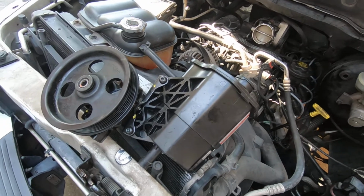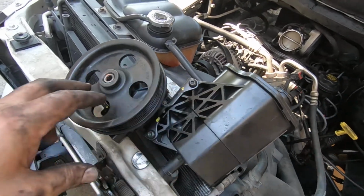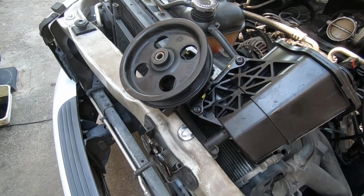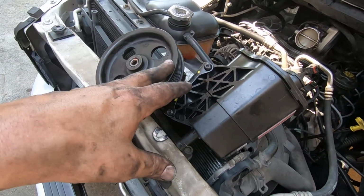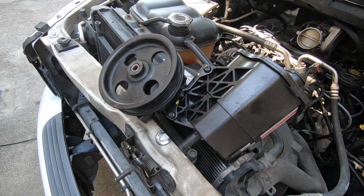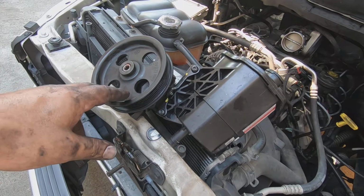All right, guys, so we're back. We got the new power steering pump. This one came with a reservoir, did not come with a pulley, so I transferred the pulley over. I probably should have filmed that. If you don't have the tools, probably best that you get a power steering pump assembly with pulley. It takes a puller. I'll link the puller in the description. If you do want to do it yourself, make sure you have the puller kit.